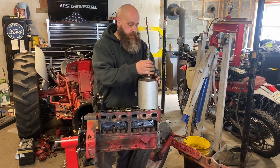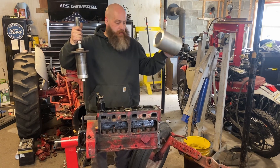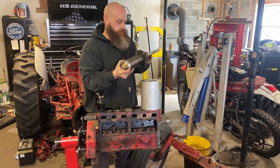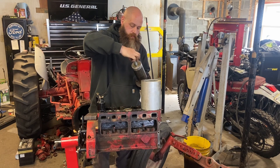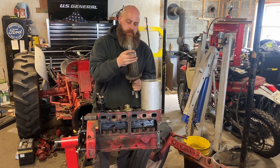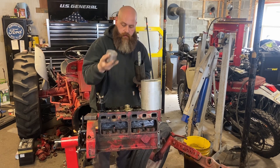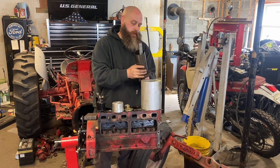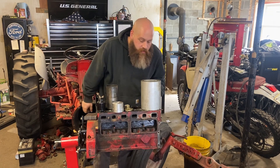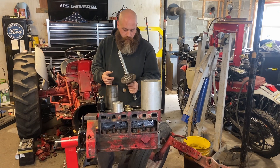This should all just lift right up through the top. We've got our tube, bottom nut and washer, out comes the puck - looks totally undamaged. And there is the old sleeve. We'll just do that three more times and this engine block is ready to be cleaned up before reassembly.